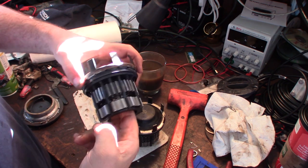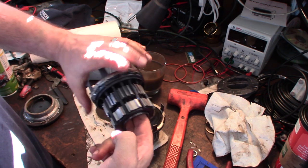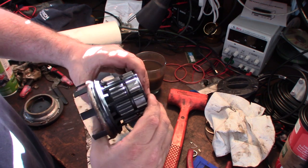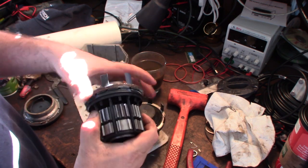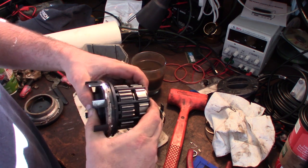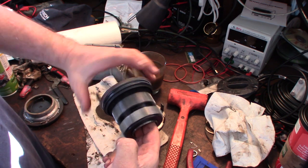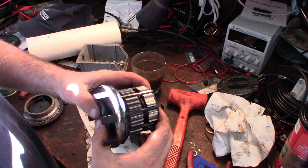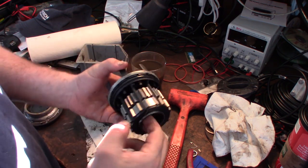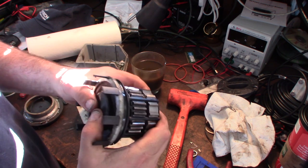I don't think these are designed to have heavy grease. These are supposed to have super light grease, because if the grease is too heavy, this thing doesn't go back and forth. It's vacuum operated. All the other videos I've seen online say that you use heavy grease, and dude, this doesn't make sense to me. You don't want to bind this thing up with grease. So, all right, I will use the light grease, light oil, and if my hubs fail, that's on me.